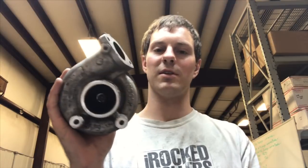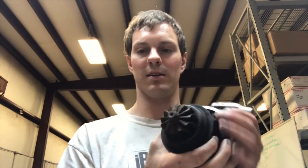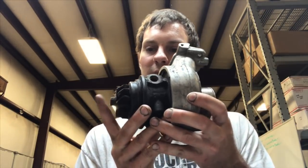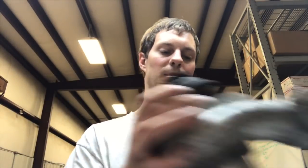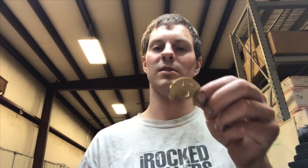First, before you even start, you want to check and diagnose why this turbo has a problem. You're going to check it for side-to-side shaft play and in-and-out shaft play. This one has a thrust bearing failure. Because of that, we know there could have been a couple of reasons why. One, most commonly, could be an oil contamination problem clogging up the thrust bearing, this piece, which blocks off the oil pressure to the thrust bearing.